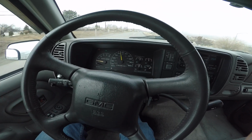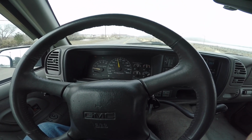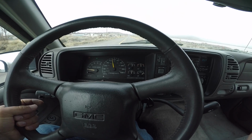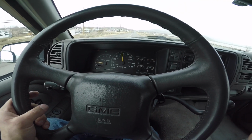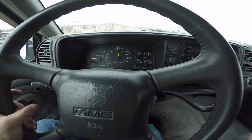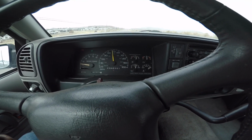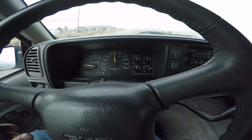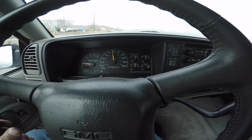I know I've gone over all of this. Tack signal, if you use a 411 ECM, all of this is pretty much plug and play. I mean, it's easier than the drive-by-wire, the 03 through 06 ones. I've been helping a friend try and get his all worked out. Takes a little more work. This is a lot more simple. The LS computer gives out a tack, which is strong enough to run this gauge. He programs that. Oil pressure, that's just your factory one, just adapt it somehow. If you have the single wire, you can use the 99 through 02 oil pressure sender. Plugs right into the block because it was made for that block, and then it has the same plug as this engine, so that's good.